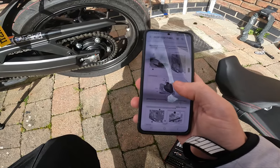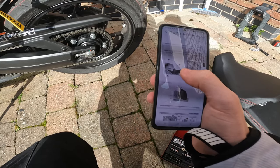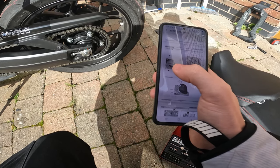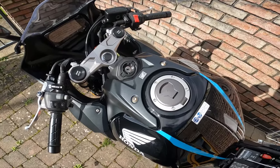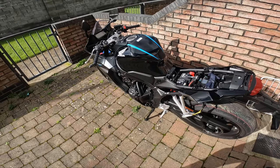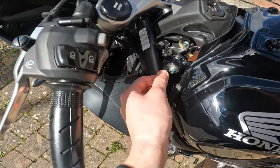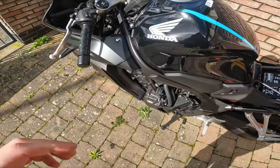Using instructions, you can download them online. So as you see, you take off the seat, then you take off all those side fairings, and from the tank this part comes up. Okay, let's see how it goes. After that, when this thing comes off, you need to remove these two screws to lift up the tank, as it shows in the instructions.